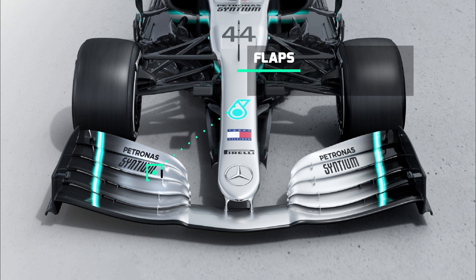The flaps are stacked winglets that work together to create downforce. Their angle can be adjusted to help the driver balance the front to rear downforce distribution at each track. This cannot be done when the car is in motion though, and is only adjusted before each session and during a pit stop. Under the previous regulations, the available area for the flaps was already too much compared with the amount of downforce needed to balance the car.